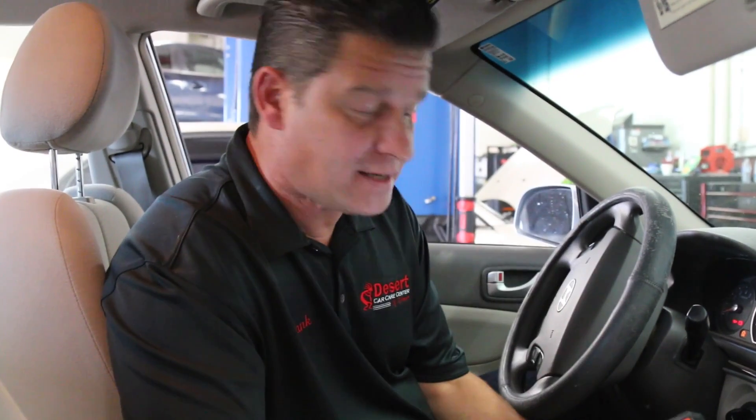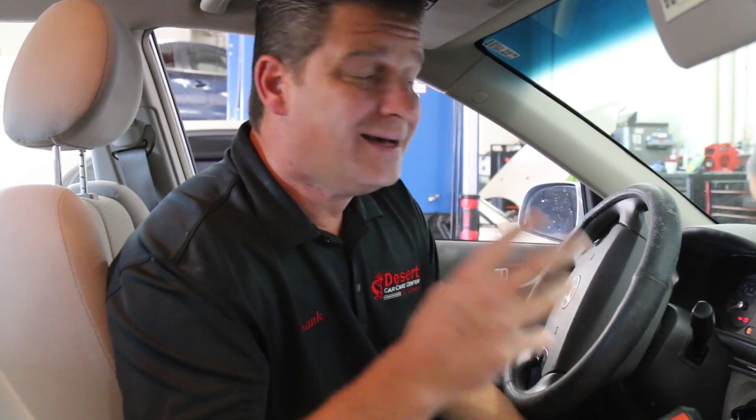What we've got is a cylinder one misfire — that means cylinder number one is not firing properly. We also have O2 sensors showing no activity, which makes perfect sense: raw fuel going into that exhaust will contaminate the tip of those O2 sensors and they just won't read. Things are pretty haywire right now, so let's get to the engine bay.